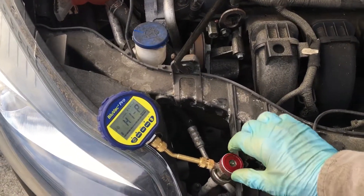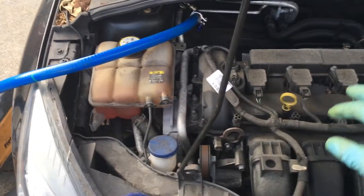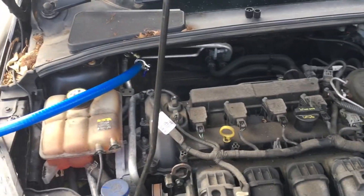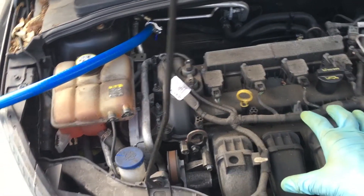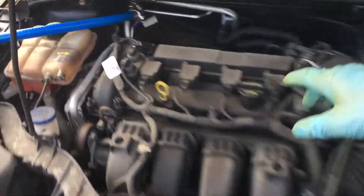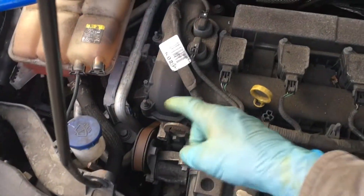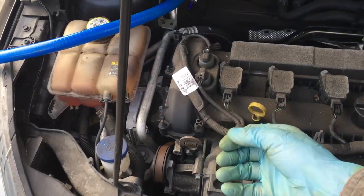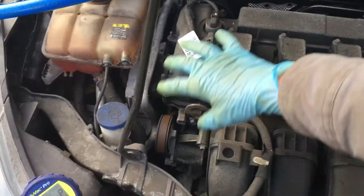It's roughly 45 degrees out right now, so it's a pretty cold car. In this situation, to help with the vacuum on cold mornings when you do cars outside or in a cold garage, start up the engine, close the hood, and pull your vacuum with the engine compartment warming up. You want to warm up all the lines, warm up the condenser — it'll get heat from the radiator. All the hoses and everything have oil that is completely saturated with moisture, and the only way on a cold morning in a deep vacuum to help remove that faster is by having all the lines heated up.